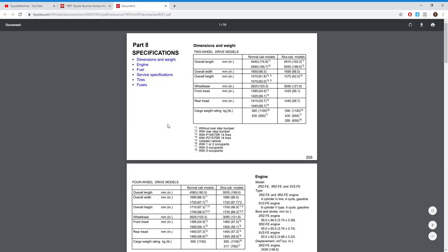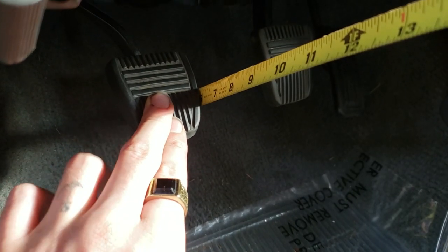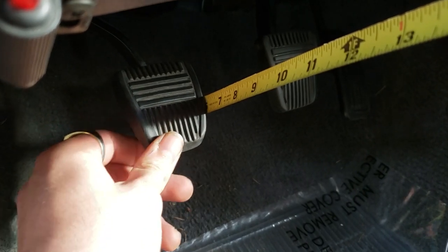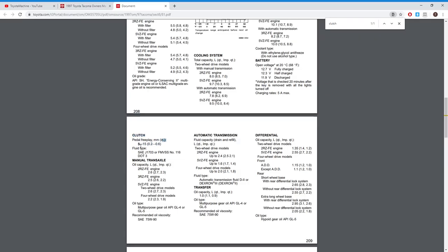A little background: after doing the clutch line on my personal truck and adjusting the pedal for the first time, I tightened it too tight, which resulted in 0 inches of play. The reason this is bad is because the liquid is already at its most compressed state, but it can still expand. So if it's a hot day and you have 0 inches of play, it can damage your master cylinder, slave cylinder, or hydraulic lines because there's no room for expansion. That's why the manual sets 0.2 inches as the minimum.